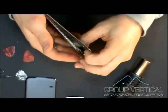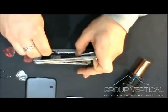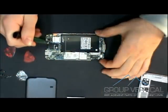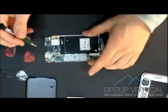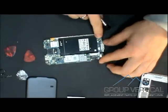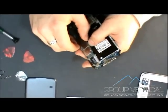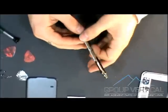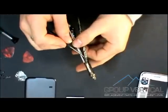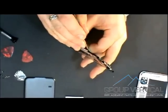You may have to pry the three tongs up a little more in order to get it off completely. Once you do this, there are two screws that you're going to want to take off in order to take off the main motherboard. When you take this off, be careful at the middle end — there's a little cable that you have to unclick. You don't want to rip that off from the frame.